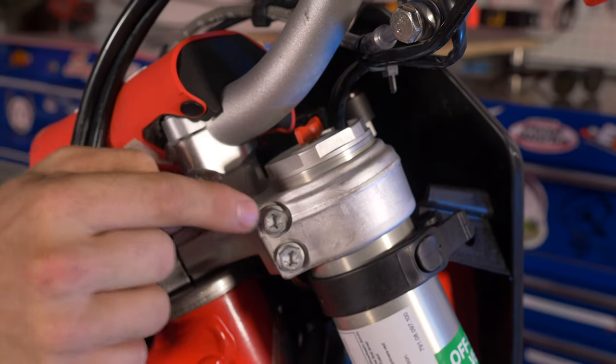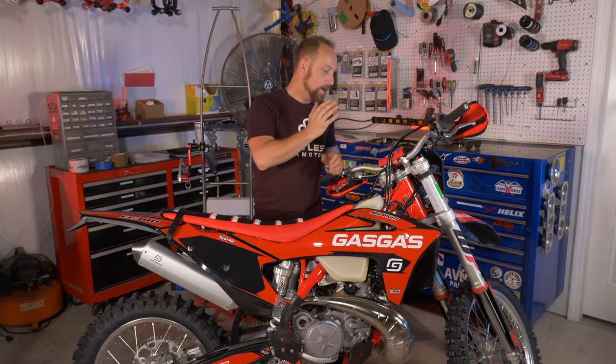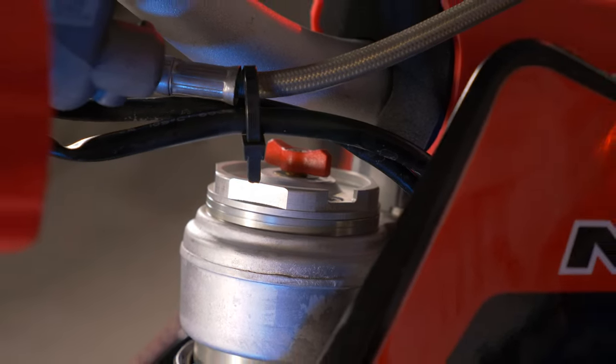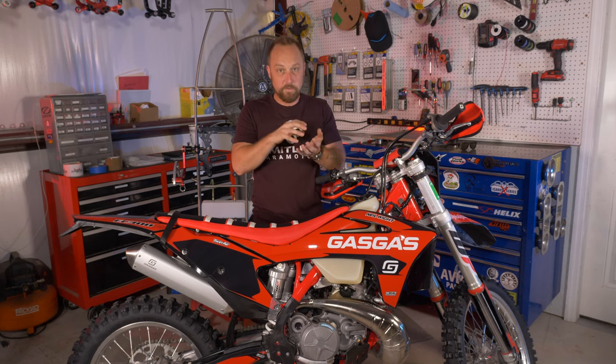And what that'll give me is a lot more nimble handling, especially at this one spot that I go to. I'm barely out of third or fourth gear, whatever. I know I'm going slow, so I'm really gonna value that nimbleness, and I can sacrifice some of that stability. You've got compression and rebound adjustment, which is how hard or how soft that suspension compresses and how fast it goes back to rebound. There's all kinds of different adjustments there.